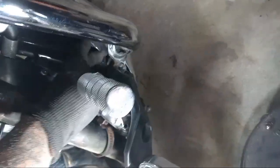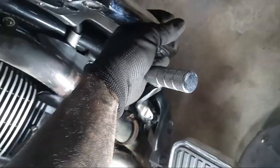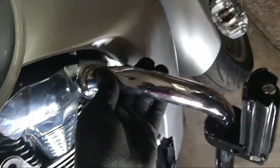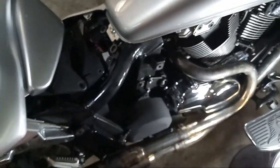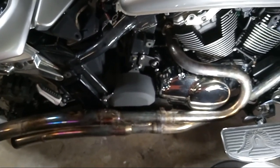That means I'm gonna have to take this front fairing off to access that hex bolt, or take the crash bar off. I can take the one crash bar off at the bottom by removing this bolt to loosen up the bottom portion. On the other side it's the same — a crash bar pressed up against it. Anyway guys, it's not that hard to do — quick video on how to take the exhaust or heat shield off.